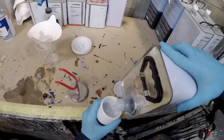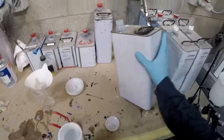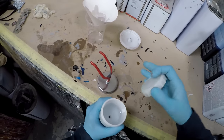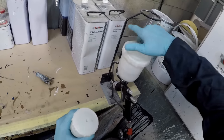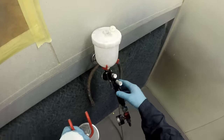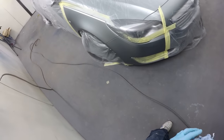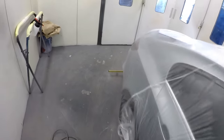I've prepped up two guns: the GTI Pro Light with a 1.2 mil nozzle and T110 air cap, which is my preferred setup for clear coat whether MS or HS. Then I've got the little Sata Mini Jet with a bit of fast thinners in it, which I'll use for the fade-out clear blend on the front bumper. I'm taking both guns into the booth so there's no changeover time — the fewer times I need to come in and out, the less chance of sucking crap into the booth.